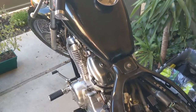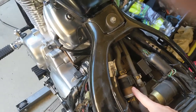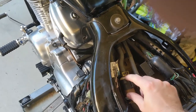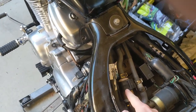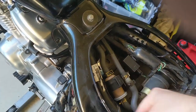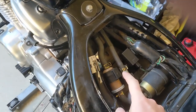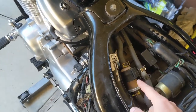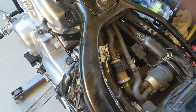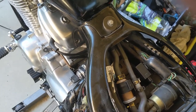This is actually day two. Yesterday I discovered a few things, including the fuel filter here, which I wanted to check to make sure it's not plugged or anything. I took it apart and just below this rubber there's an arrow that gives you the direction of the gas flow — in this case towards the pump. This was actually incorrect; the filter was inverted. I unplugged it and put it the correct way, which is what you see right now. Always make sure it's in the right direction with the arrow giving you the sense of the flow.